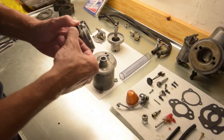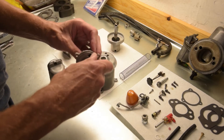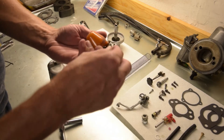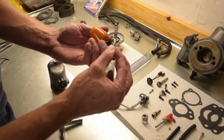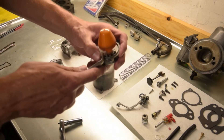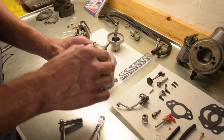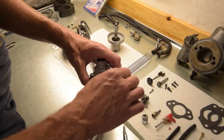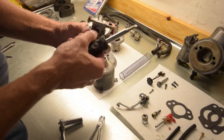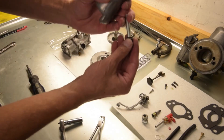Now we're going to rebuild this carburetor. We'll put together the fuel housing — take the top, take our new needle seat and gasket, place in our needle valve, take our float making sure that the pin with the knurled edge is on the outside, and push that in until it stops. Then take the housing and our new gasket, take our screws — always best to put them on just slightly tight so you can get all the bolts on and then go through and tighten them.